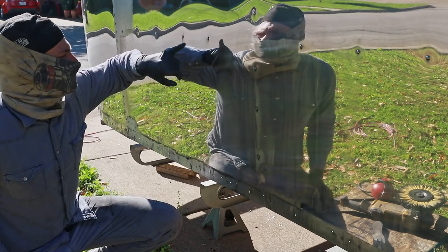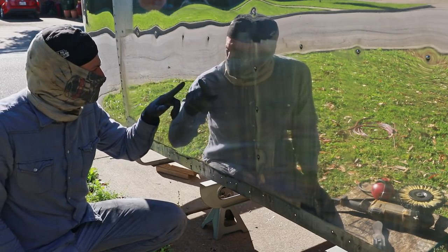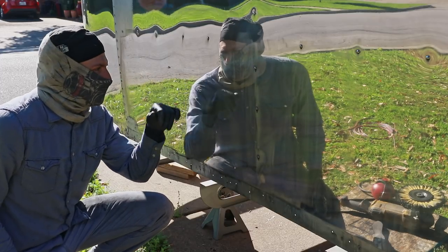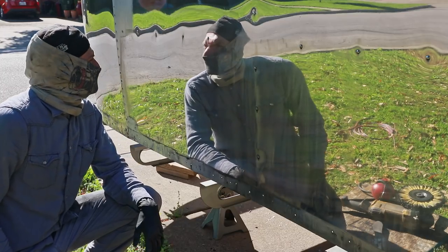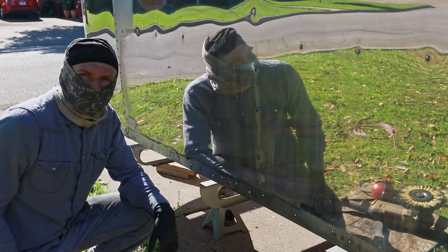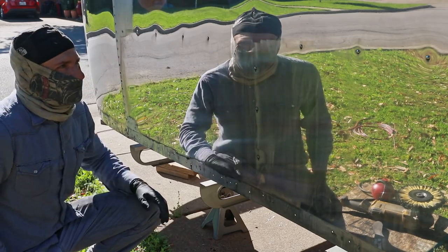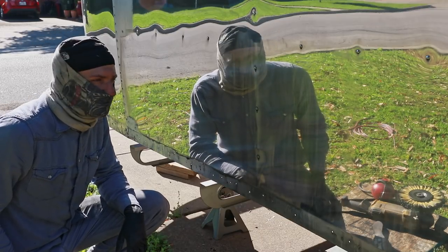All the corrosion spots around the rivets is cleaned up, and the scratch is reduced dramatically. And it kind of smooths the scratch out to where it doesn't have as sharp edges, and so it doesn't hold dirt and stuff in it, so it won't be as noticeable. So yeah, the cross cutting method works really good whenever you have some of those tricky spots. So we're gonna get the SCT back out and finish up this area, and then this section will be done with the first stage.